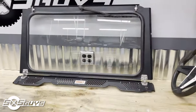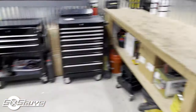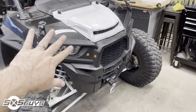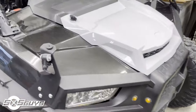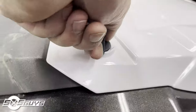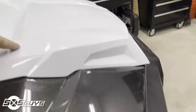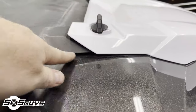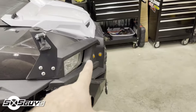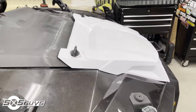The window is fully intact — nothing wrong with that. But when we nose-dived, it pushed the front of the car back a little bit. Right now the hood has a pretty stiff hold, but it doesn't lay flush with the car. I need to figure out what bent in the front fascia supports and bend it back so the hood lays flat again.